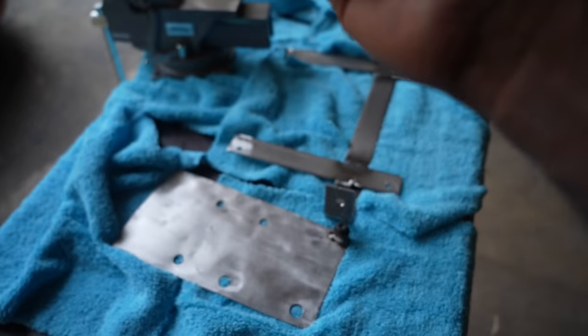Now, not all of the cables are going to be passed through the firewall. It's only a handful of cables, but one of them is a positive. I could run the positive from the back, but I'm not gonna do that. I will tap the positive from the front. You see that in the glove box, there is this thing here. You can just pop this out, and that's where I passed in this cable. So it's easier, and we're not drilling anything.